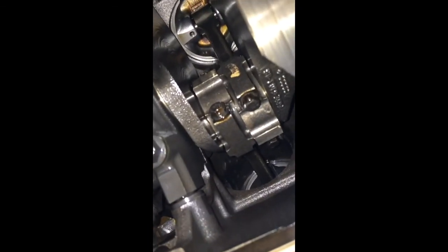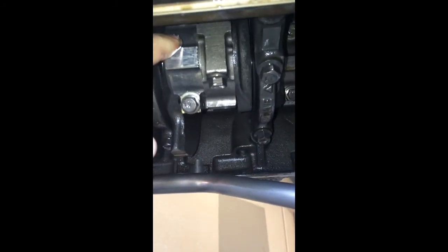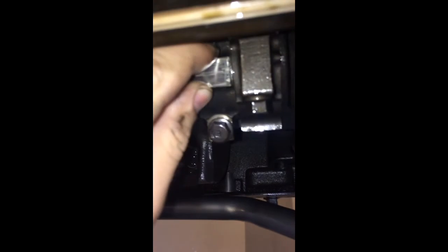That's pretty much why. And so in your crankshaft here, each one of these rods has a bearing on the inside of it, and what you see, this metal flake in here, that's pieces of all the bearings. Now when you get in here, a good couple signs of it would be the caps right here. Your caps would be black, they would look burnt, or they would be super loose. Now mine aren't that loose, but you can kind of hear it clicking.